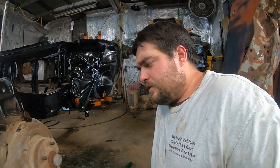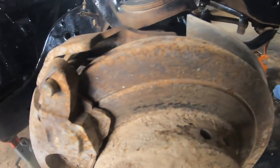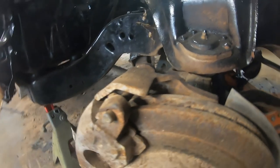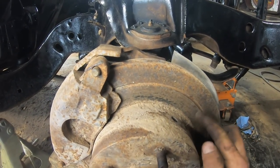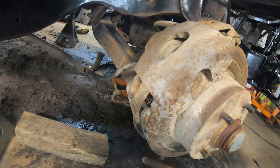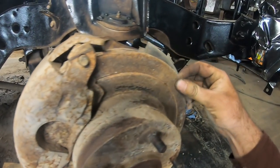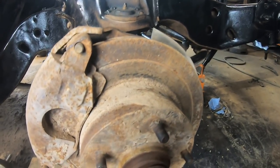Well, first impressions here are less than good, I should say. Whoever ran this last, they wanted every penny out of those brake pads. Now, this groove is actually factory, so that's an original rotor, I would assume, or a replacement from the dealer or something. But this one actually looks okay. I mean, yeah, I hit it with a wire wheel, call it good. But let's go look at the other side.